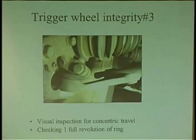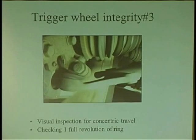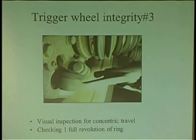You see that? That could really screw you up because you're getting a really erratic pattern. And even on the scanner, hopefully, I mean, you don't always see this on a scan tool. It may not always be guaranteed because it can get so intense at low speed that the scanner may not show it, but a scope will always show it. And you have to compare.